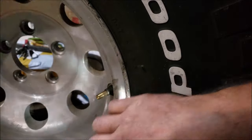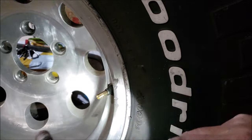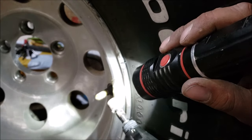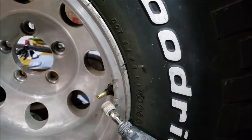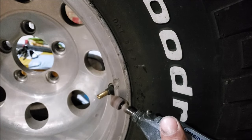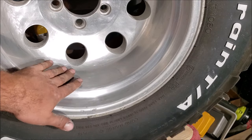We're gonna polish the lug nuts with quadruple-zero super fine stainless steel wool. The super sketchy hard part is sanding out these little gouges because when you're running your polishing rag it'll snag and screw it up — it won't polish in the middle. So you've got to figure out a way, like using a little Dremel, to deburr that.